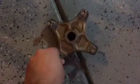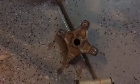So as you'll see, you see the A-arm knuckle, and this is the A-arm knuckle here. We've taken that off, and then this is your, I call it your outer spline, where your tire just bolts up. So anyways, we took the spline off the end of here, your CV axle, your upper A-arm, and your lower A-arm is where my knuckle connected. So you see my knuckle right there, and slid that off, unbolted the shock. This is the lower part of the shock right here, and unbolted it from the lower A-arm.